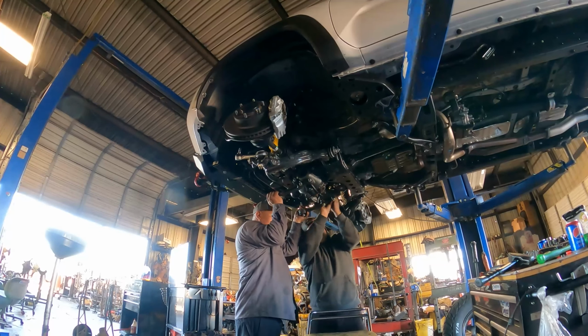There's a lot of people that try to wire wheel this stuff because they put a coating on it. They put a glue coating on it first because the glue is just for rust and this and that when they're shipping it, to protect the gear. But then there's another coating underneath that glue that you got to be careful not to take off, because that's what hardens the steel. Yeah. Makes sense.